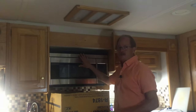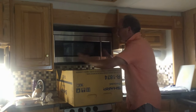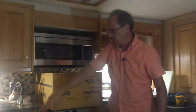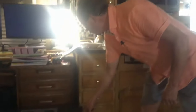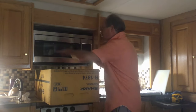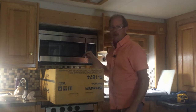The oven is back up — I'm sorry we couldn't film while doing it because Jen had to help me. It weighs about 70 pounds. We rested the oven in the grooves just like when we lowered it, put the back on the track against the back wall, and lifted it up. There are two bolts underneath that go up on an angle to hold it. I then secured the two brackets on top — the ones I drilled out from the old oven where they were riveted — using the existing mounting holes. Now I just need to put the screws in while Jen holds the oven up so I can line it up. It'll be mounted on a track underneath, two angle bolts going to the back wall, and two screws into the metal channel on top — very secure.